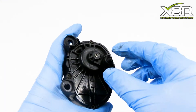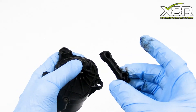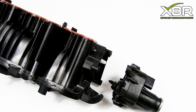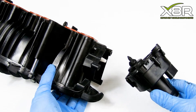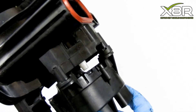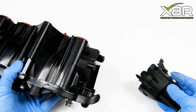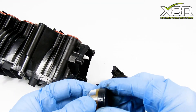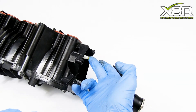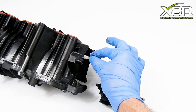On the previously removed motor, disconnect the swirl flap rod rotating arm as this is no longer needed. When refitting the motor, the bung should fit snugly against the motor. If it does not and there is a gap left, as shown here, you will need to fit our spacer. Fit this to the end of the bung that is already installed, and now place the small black spacer on the end of the greased bung.